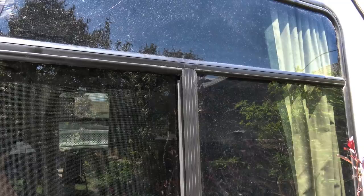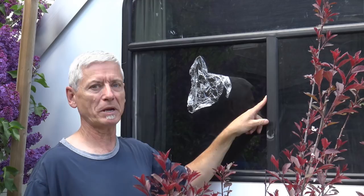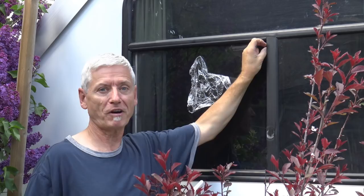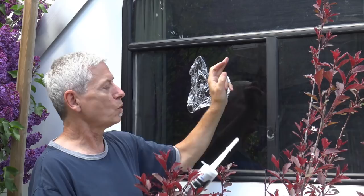From the outside it was pretty obvious where the water had entered the trailer. The problem is the rubber weather stripping has shrunk over time, leaving a gap at the top. It would be great if I could just replace the rubber weather stripping, but chances of finding that exact model are pretty slim and A-liner isn't going to provide it. So I'm going to Plan B: RTV sealant — a black silicone you can get at most auto supply stores.